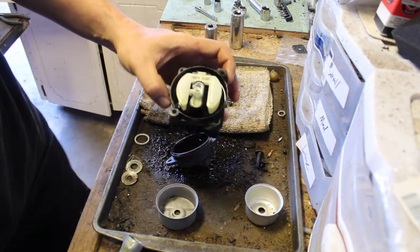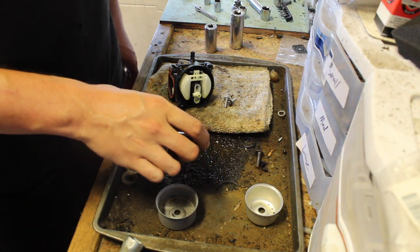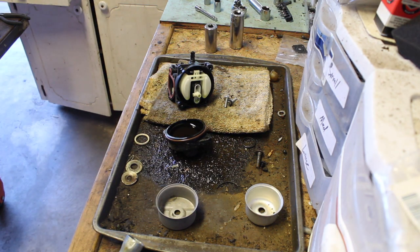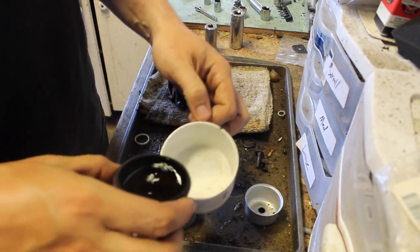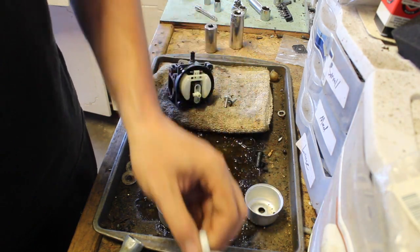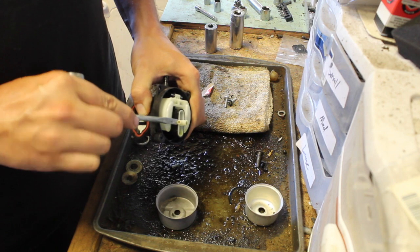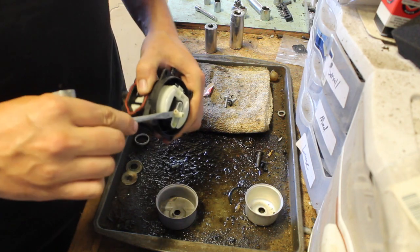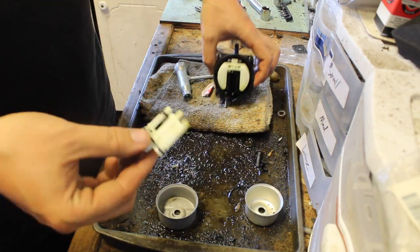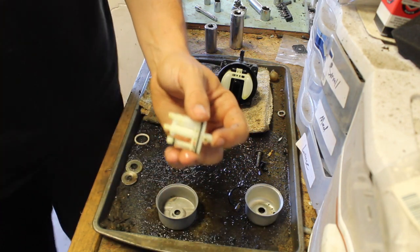I know the problem already. Let's get a cup — I smell it. It's not the cleanest cup, but we're not looking for junk, we're looking for color. Does that look a year old to you? And by the amount of spiders I've seen, I think it's been sitting for more than a year or two. Luckily, to fix this is really easy — take this out, put your finger over this, and blow in there with a compressor.